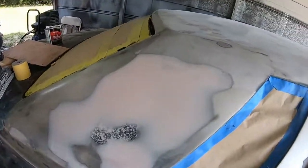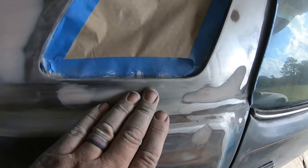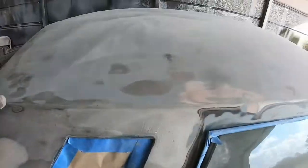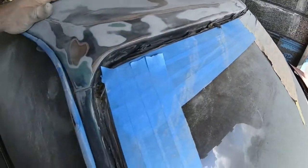Went ahead and got the compressor full. This is all sanded down nice and smooth - got a few little pieces there but it's nice and flush. This right here needs a little bit - this is a low spot. This is level but it's a little low right here. This spot is good. This spot I did fill in but it needs just a touch more. The roof I went ahead and did sand, and I cleaned up the edges here. The roof is ready to primer - not spray can primer but actual real primer.